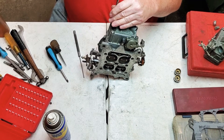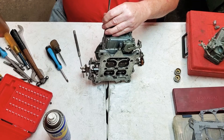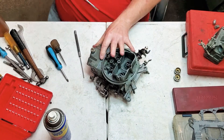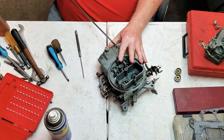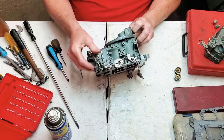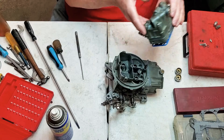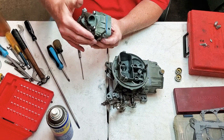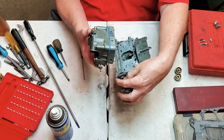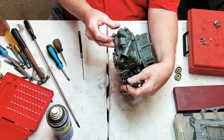I've got the little plastic washers on here - I wish I had the paper cardboard ones because this carb has been rebuilt so many times I don't know how well it's going to seal with these plastic washers. Alright, here's the secondary - we've got our pump on it. The last thing we're going to do is adjust those pumps. Let's get the primary in - we've got everything built up just like the other pump, all new parts in it. Bring the bowl down and make sure the arm slides under it, then spin them on.